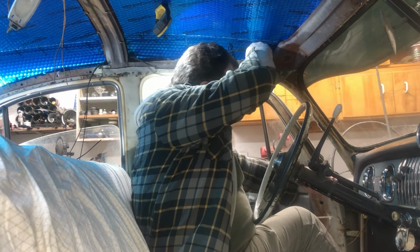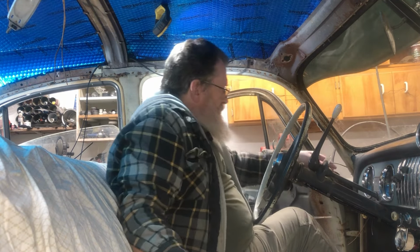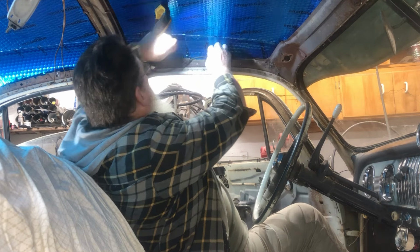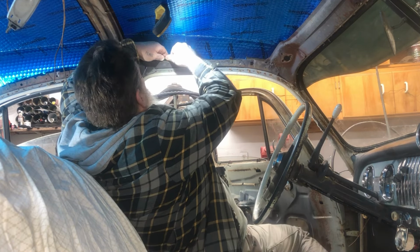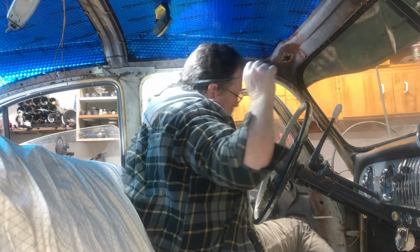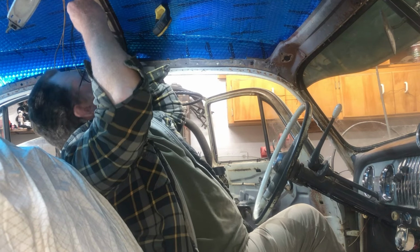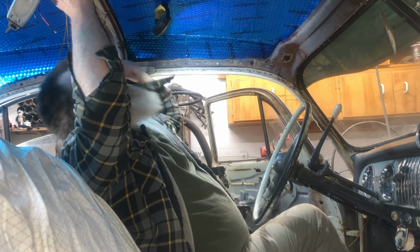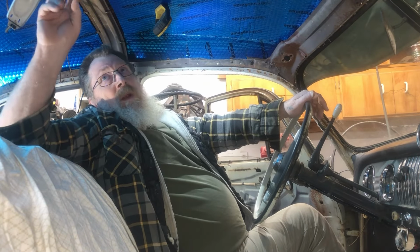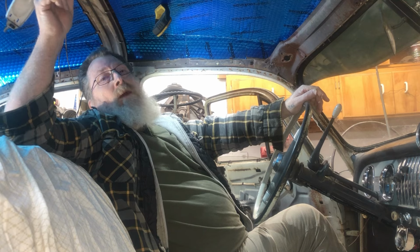So I got most of that wrapped. Got the wire sticking out here for the little door button. I'll put this wire back up here, being all replaced. All right. Almost cut myself short. That'll work. I got enough. Then I just run another wire down the other side, down the other door post the same way. That's pretty easy. That's a single wire. Those are only grounds. All I do is run a hot lead up here and wire the switch.